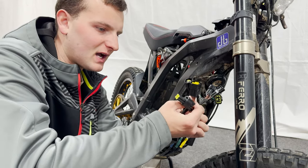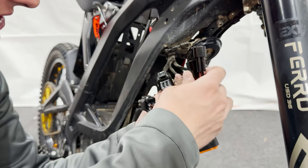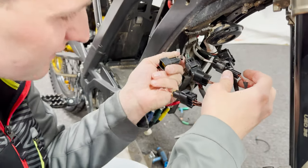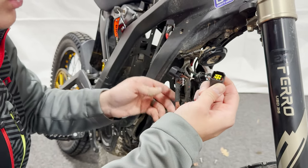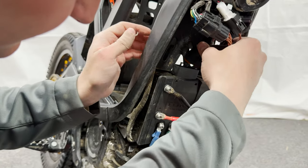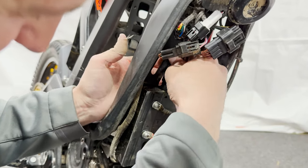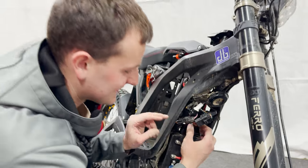We're going to plug these five connectors in here. First one in, second big one in. Third one connects here. Then we have our display — pull the cover off since we are using the Torp display; they cover it in case you don't use it. That snaps in, and then we got our regen lever connector — the white one. All five are connected. Now we're going to take the main connector and plug it into the top — wait till you hear the click. It's a nice click.